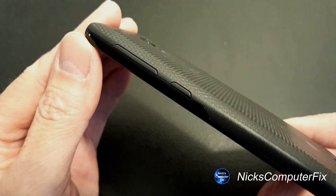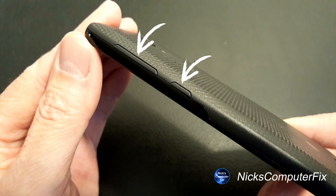Let's go ahead and reset this phone back to factory default settings by locating and using two physical buttons on the phone: the volume button and the power button. On this TCL A1 they're located on the right hand side. Yours might be in a different location — on the left hand side or both on the right like this one. It doesn't make any difference.